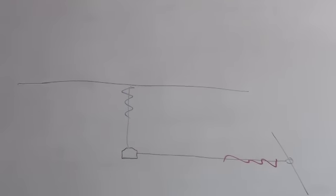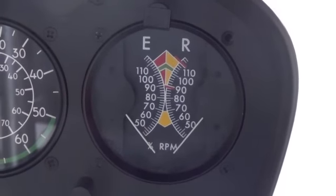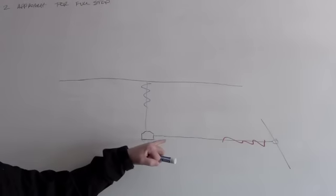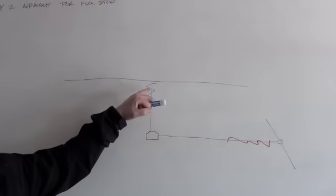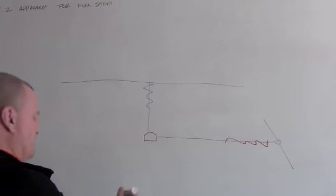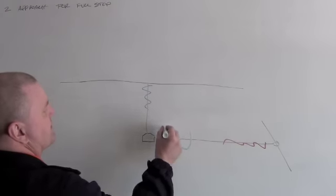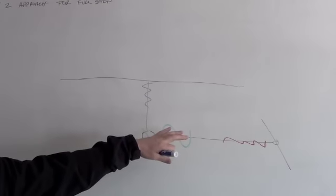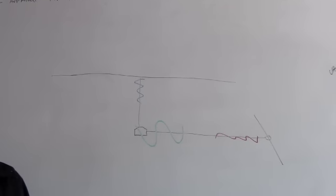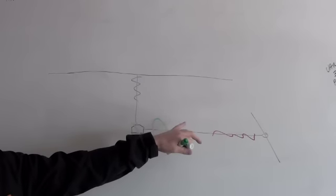On the R22, we are told to avoid the area between 60-70% because of sympathetic resonance. What happens there is, as these vibrations come this way and these vibrations come this way, when they combine they enhance each other and make it a lot bigger — a lot more harsh vibrations. If we leave it there and let them build on each other, they will just keep building and will literally tear this helicopter to pieces.